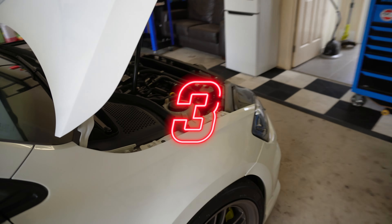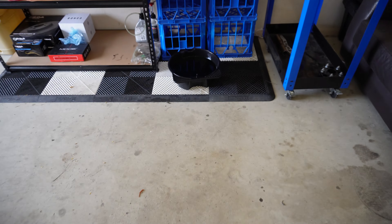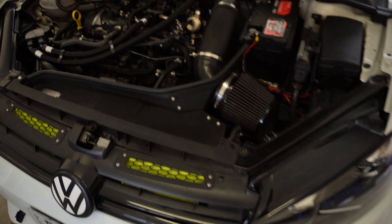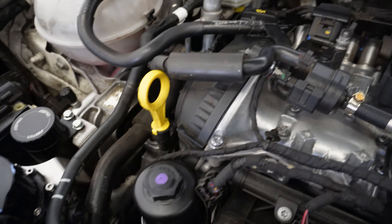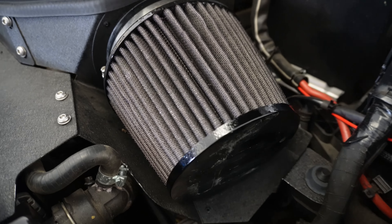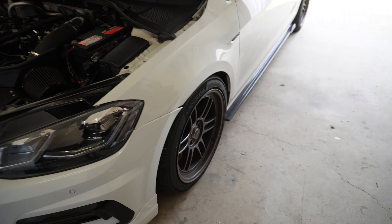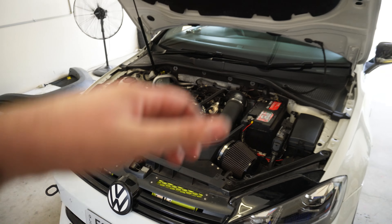Jackie's car is done. Oil's looking a bit more healthier than last time - that's what we love to see. No specks of metal in the old oil filter. All torqued up, oil's refilled, dipstick's back in, cleaned the oil filter. This afternoon when it comes back in for the haldex we'll do the engine bay detail and give the old shoes a bit of a wipe off too.